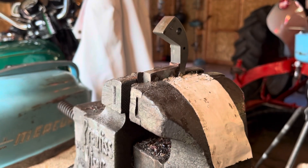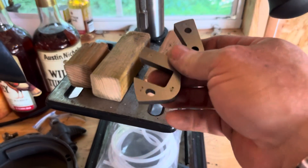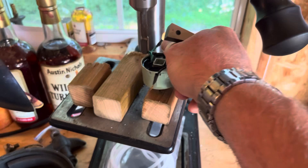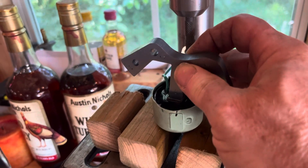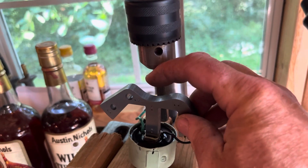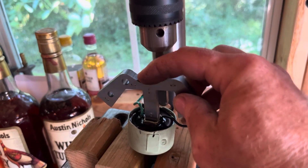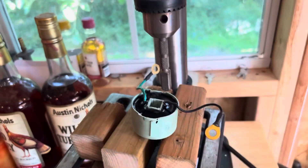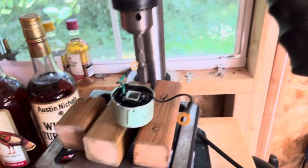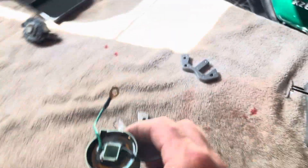Once you have that done, you bring it back over to your little press. I'll use the OMC one since the other isn't ready yet — just pretend it's my Mercury laminate that I filed down. You put that in there, put the coil on here, then raise up the drill until it fits right in the cradle and push. That will press your cheap OMC coil onto your Mercury laminate.